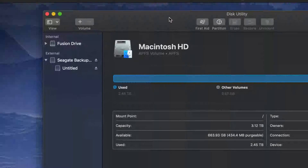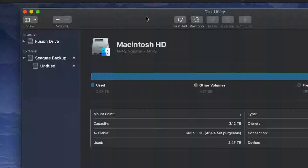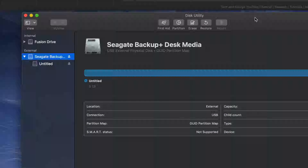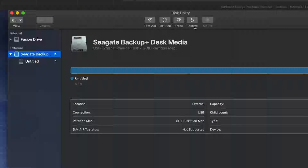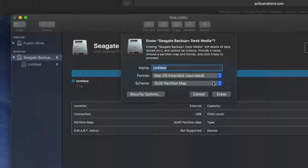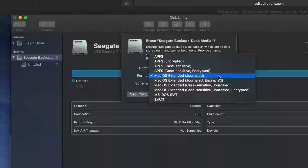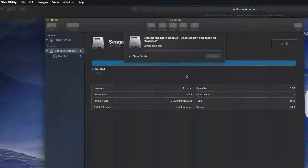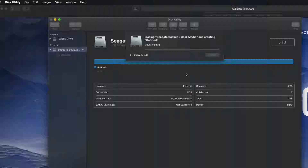The way you should set it up for your Mac: we're gonna do a Time Machine backup, and we're also gonna use it like a USB stick. First, we should format it to be compatible with both Mac and PC. Under 'Erase,' if we click on ExFAT, ExFAT will be compatible with Mac and PC. Click on Erase and you're good to go.